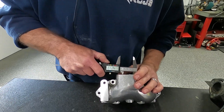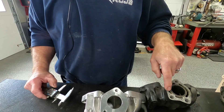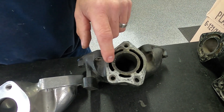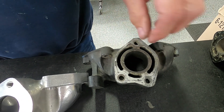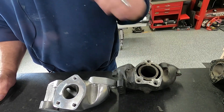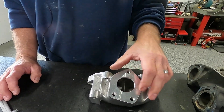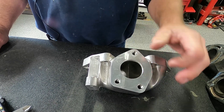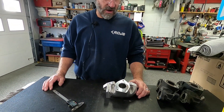Gordy's aftermarket manifold here measures just a little bit over 42. The biggest thing is these have water passages that come up to the top — your gasket blocks this, you don't want water flowing through there. The water passage comes all the way to the top; you can bore this a little bit, but not much. I'll take a couple of millimeters out of this, but you've got to be careful because if it gets too thin your gasket won't have a good seal, so it's not necessarily optimal. The solid-top manifold — even though it starts out bigger — you can bore that another couple of millimeters and make it a little bigger to match whatever head pipe you're running. It's important to port-match your head pipe, or even bore your head pipe up a little if you're running a larger engine. We do that with dual carbs and let it breathe.